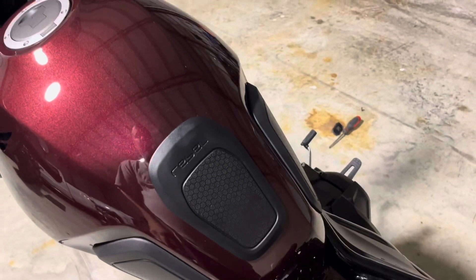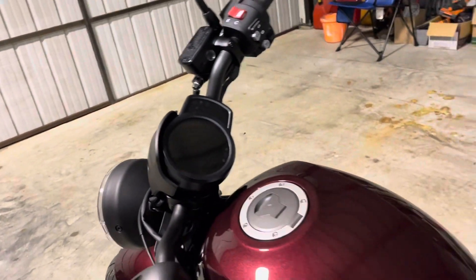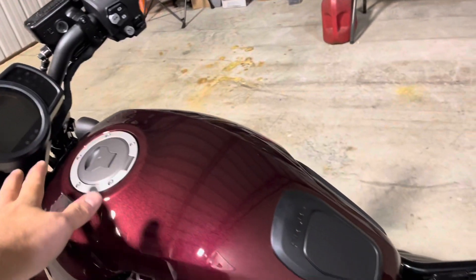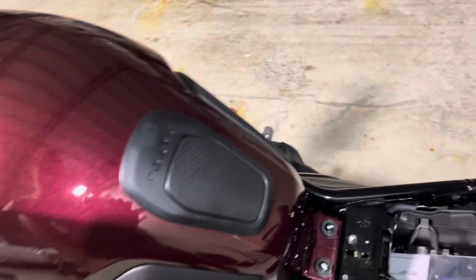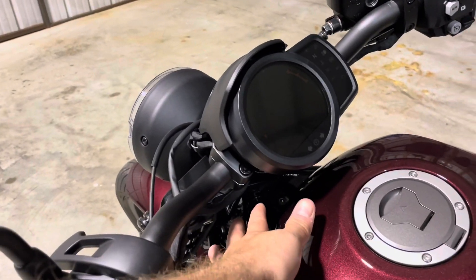Here's how you do that — you will at least need to do this part. These two bolts here and that bolt up front that I was showing you. Unless you have a universal joint, you're going to be using a long Allen wrench for about 50 turns — it's a long bolt. With at least those three bolts removed, you can lift this up. I suggest getting a helper to assist. Otherwise you can lift it up and put a block underneath right here — the tank should not go anywhere because it's well seated.